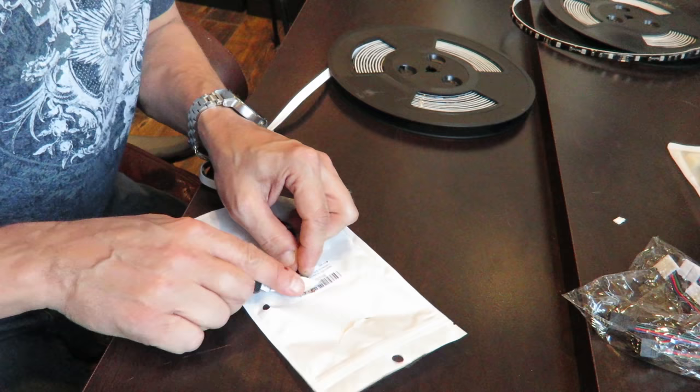Now we'll take it and look at our wires, blue, red, green, and black, going to our connector. Those are marked as well on the tip of your LED strip where the contacts are. The blue is on the side that my finger is on right now. So we'll line up the blue here. You're supposed to slide that LED right in there underneath the contact points. It slides in really nice if you got it peeled back the right way like we just did, and then clip it. It should make a little clip feeling there, and we've got it. And that's all you do.